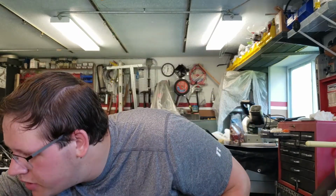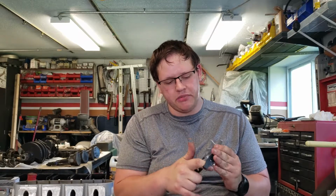Once you have your valve seals in, next thing you're going to want to do is put on your valve springs. But before you can put on your valve springs, you have to decide what kind of valve spring compressor or valve spring tool you're going to use. I have a few different options here that I'm going to show you and give you my personal opinion on them. First one is going to be this standard little valve spring compressor that you can get at any auto parts store like O'Reilly's or AutoZone.